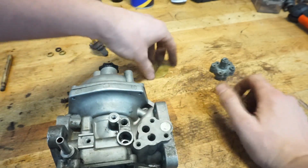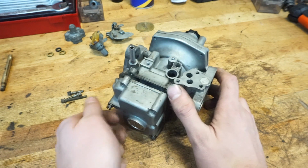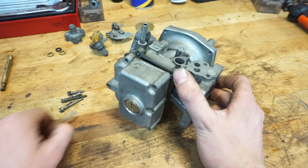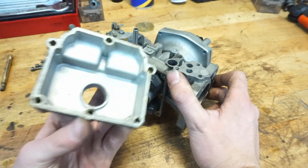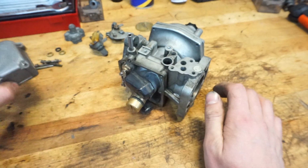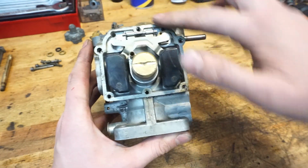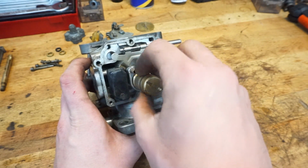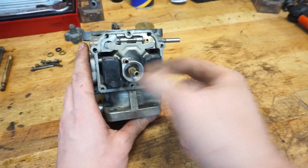So let's go into the inside of this carburetor, and this one is already mostly taken apart, because it's not hard taking things apart. We all know that, so I'm not going to spend too much time on that. This is your float chamber, very specific size and shape. We can put that aside. Then we normally have a very nice gasket around here, which can be really leaky sometimes. And right in here there's a huge screw. This screw actually covers up the jet.